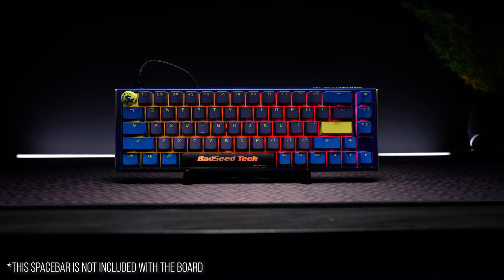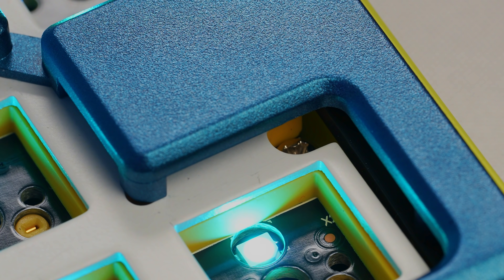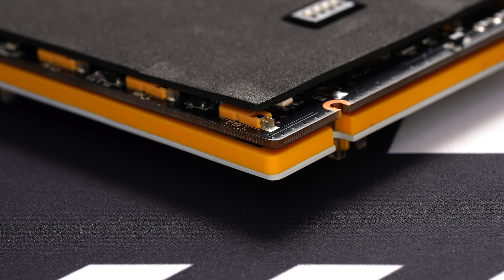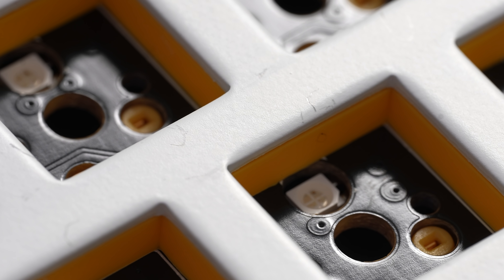Overall, I think regardless of which version you go with, these are now mechanically the best versions of the Ducky One series, unless you just have to have an aluminum case. They've really left us no reason to have to open or mod these boards in any way, which is good — because opening a One 2 Mini is a piece of cake, but opening this SF is definitely a chore. Two of the top screws are obscured, so you'll have to remove the case top, there are lots of little clips, and the end caps have to come off first. I broke a clip trying to get it apart to check out the insides so you don't have to.